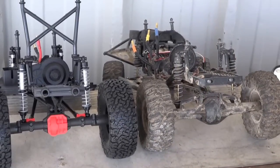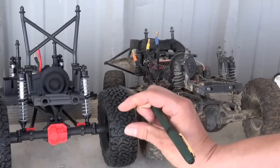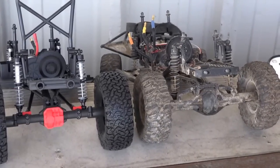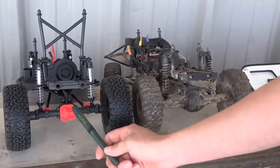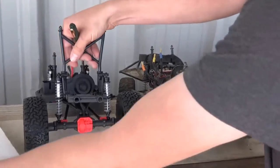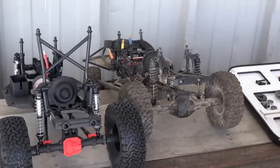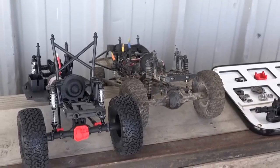What is new compared to the SCX10? You can see right off the bat that the axles are completely different. They really went far on their design for a scale axle, shrank down everything to give you a lot more clearance underneath, and they also went with a taller tire for this kit, which is good for wheeling around and better ground clearance. They reduced the size of the ring and pinion, went with M4 threaded links — much thicker than previous models — and upgraded everything in the transmission and axles to be full machine steel in the gears and cast steel where possible.